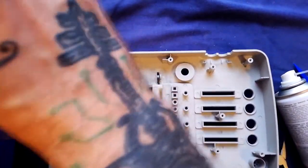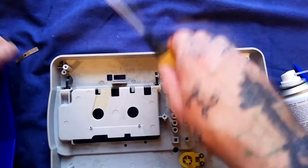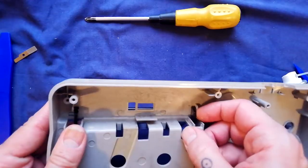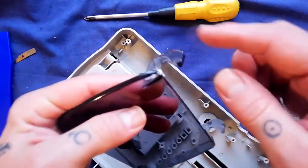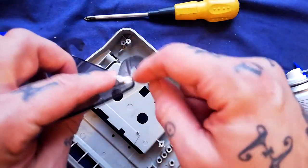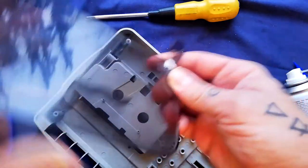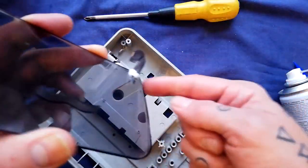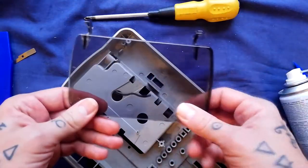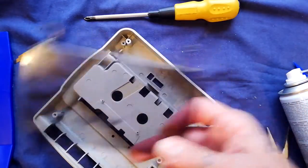Last thing is the removal of the door — you may find you have a broken door that needs fixing. There's just one screw holding in this leaf spring; the downward slant of the leaf spring wants to point downward to keep the door open. Push these in very slightly and the pins on the hinges fit through little holes. In my case, when I received this, the door was broken in two halves — I glued it first with super glue to keep it steady while I spin welded it. The melted plastic is fused with the original acrylic and I filed it down so it fits in the recess — now a very strong repair. I've got a whole section on my YouTube channel about spin welding if you want to investigate further.